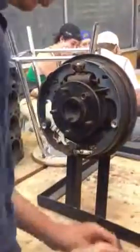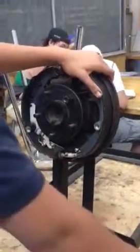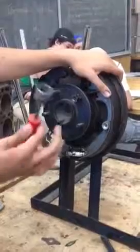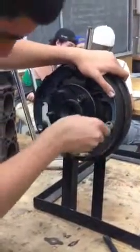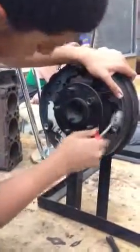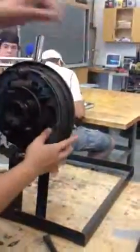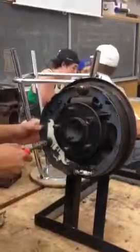Put the anchor plate in the middle, put these two on the side where you take them off. Now we've got to get rid of these — these are the holding springs. You have to use the holding spring tool to hold the pin with it. Do the next side the same way.